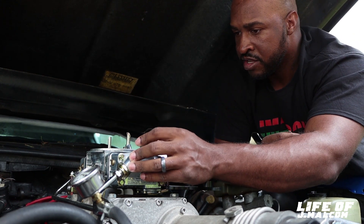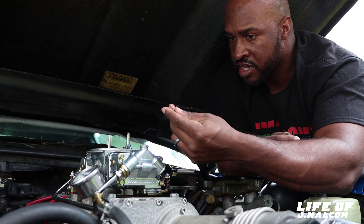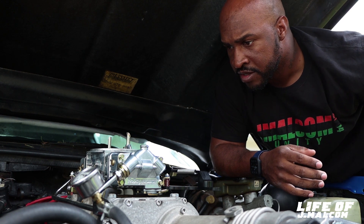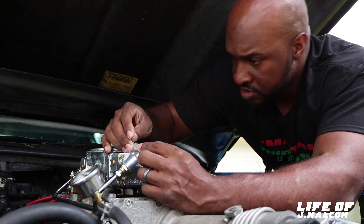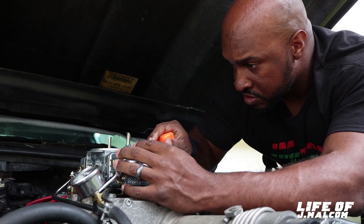My S10 — man, that cheapskate did this junk one time, boy. It was shooting up bad. I ended up having to get a new carburetor anyway, but this one's brand new. You just take that out — this is just a lock. This just locks your adjustment in place. But then this right here just pulls off. You pry it off. Gotta be careful not to tear that gasket — there's a gasket on here.